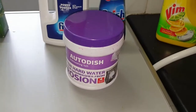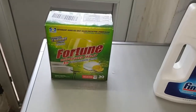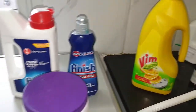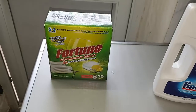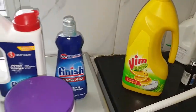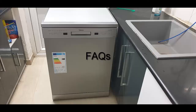Regarding detergent: if you are using tablets, nothing else is required. If you are using detergent, you will need rinse aid and salt separately. Tablets contain rinse aid and salt already. There are some questions like whether you can use vinegar when you've exhausted your tablets - yes you can use it sometimes, but not regularly - only in an emergency case, once in a while.